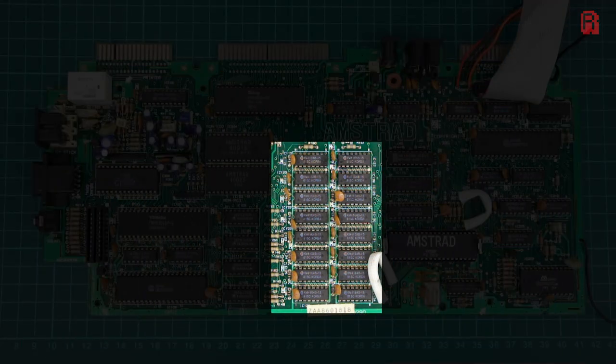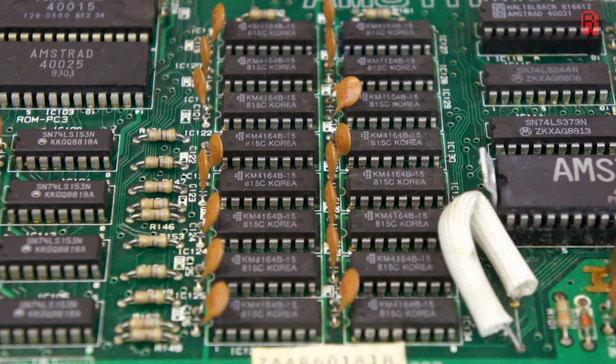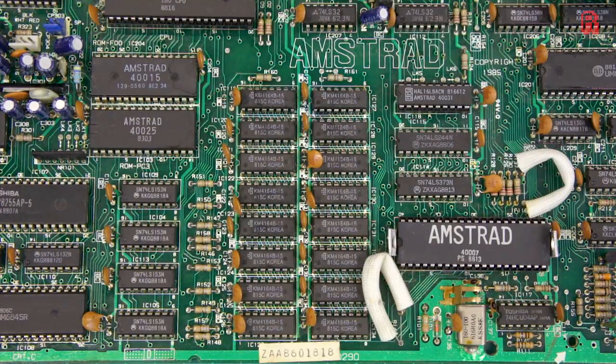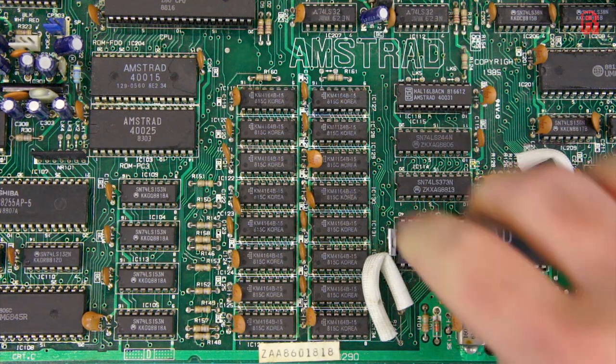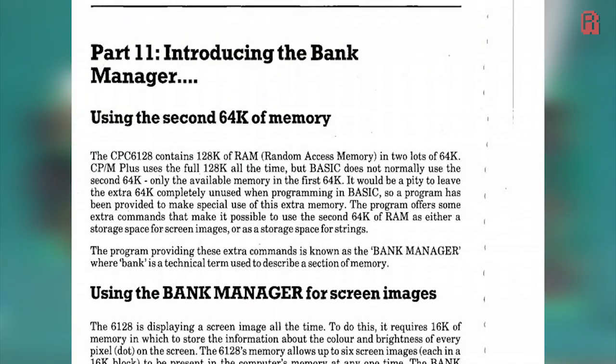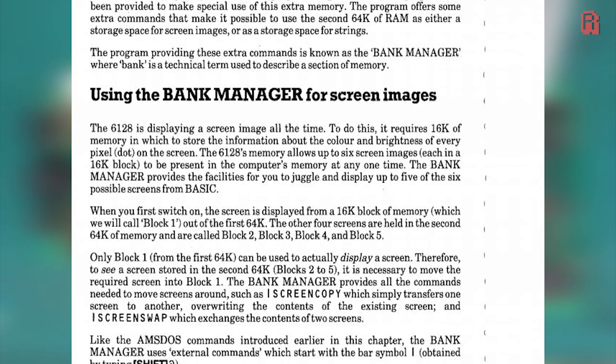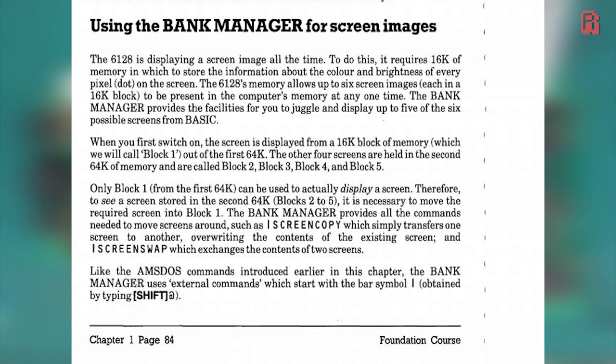The CPU may be the same as my 464, but RAM is certainly greater — double in fact, at 128K. The CPU can directly address 64KB because it has 16-bit memory addressing, so a technique called bank switching is used to access more RAM without the expense of a CPU with wider memory addressing. Bank switching doesn't allow the CPU to access more RAM at the same time, only different RAM, so the key is to not switch out memory in use by the program. Using 16K in a second bank of RAM to draw the screen and then swapping it into the RAM used for the video chip is known as page flipping or double buffering, and can give you smoother, flicker-free graphics. Games would likely use machine code, but bank manager and screen copy BASIC commands have been included in ROM for such functions.